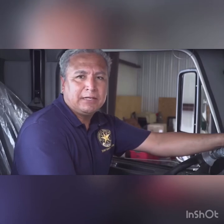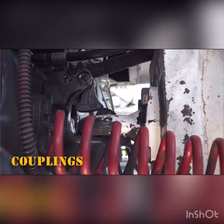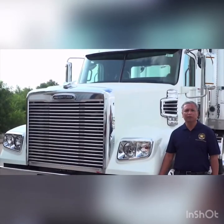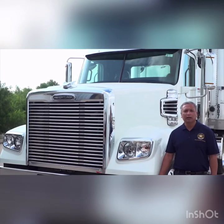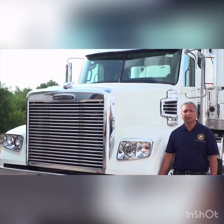Taking the time to learn the safety and security aspects of the vehicle will help you prepare for the pre-trip portion of the CDL test. This module will identify the components and exterior features. To ensure both driver and passenger safety, always check that both the inside light controls and the outside vehicle lights are working. This includes turn signals, high and low beam headlights, four-way flashers, tail lights, and brake lights. When checking any vehicle exterior lights, look for damage such as cracks and make sure the lights are clean. It is acceptable to request assistance from the examiner when checking the operation of the lights.